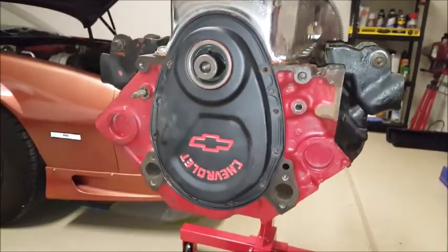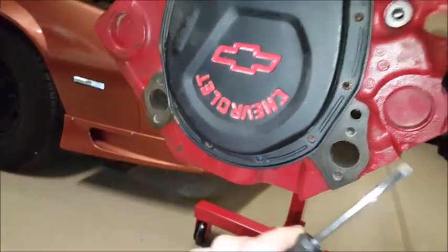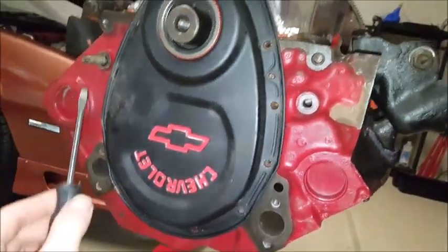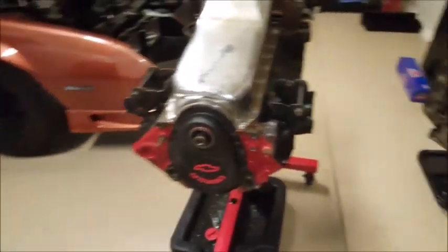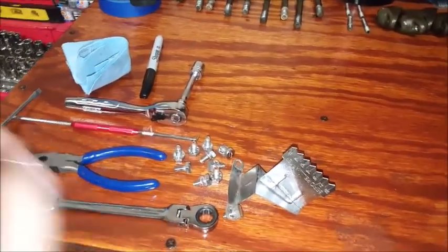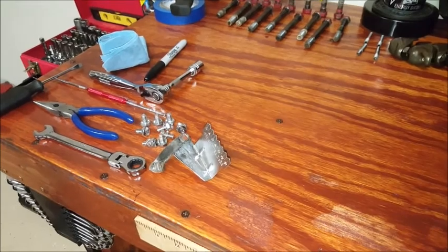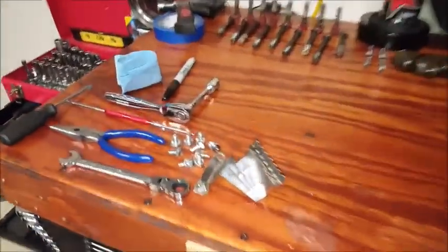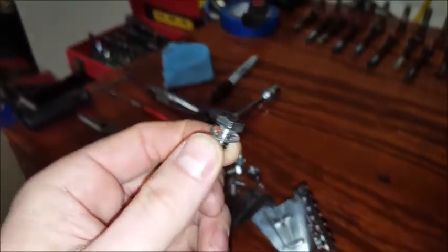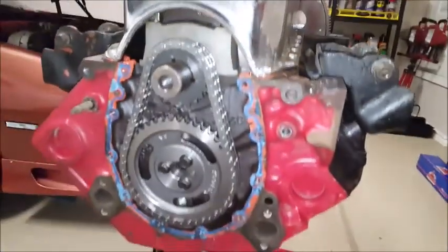I got all the bolts removed. It's still being held on by the gasket and RTV, but in order to get it off you're just going to get a flathead screwdriver, start on one end, crack it on both sides, then move up a little bit on both sides and keep working your way to the top until you can basically pull it off. Keep everything in one location — put it in a bag, mark it, put it with everything else, and keep track of all the little washers.